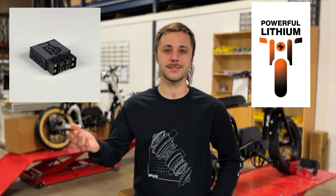We see this all the time where there'll be a company that has a battery that is half of our size and they are claiming they're going to be getting 75 miles on that range, and it's just not physically possible. If you do want to get more range out of your bike, you can always do dual batteries. But also keep in mind that you can buy the classic bike with one battery, and then down the road you can get a battery blender and add any size battery you want — if you wanted to get a 52 volt 50 amp hour battery and strap that onto the frame and use a battery blender, you could do it. We've really tried to make the platform as open as possible so you can do whatever you want.